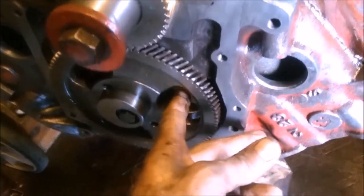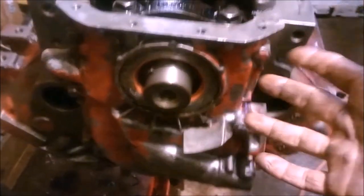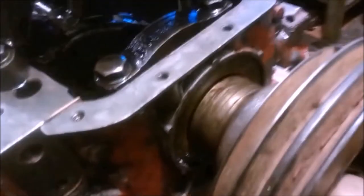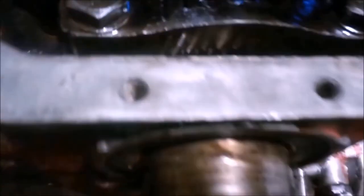What we have to do is install our balancer pulley setup. Lube up all surfaces — all around inside everything — then line up the keyway and install. We'll tighten it down with the impact once it's hand tight. This way we ensure that the timing cover, which is a little loose in here, is centered around the pulley surface that rides in the seal.